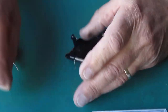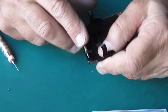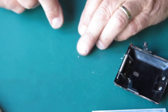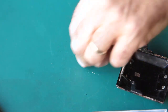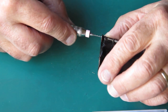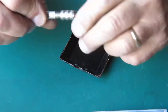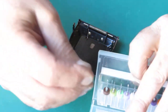And it's gone. There's still thread in there so we're good. Well, there's our screw. It's pretty tiny, considerably smaller than my finger. The drill bit just goes through that hole and no more — that's a 1.1mm drill bit. So very likely that thread was 1.2mm as I said.